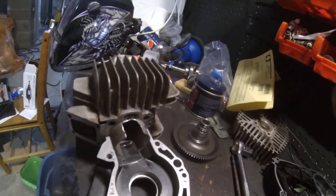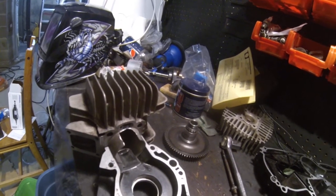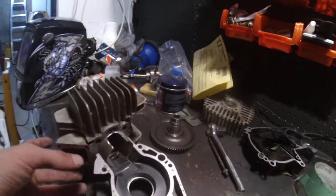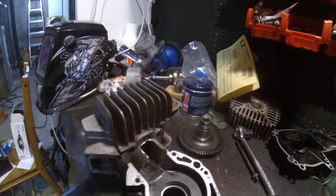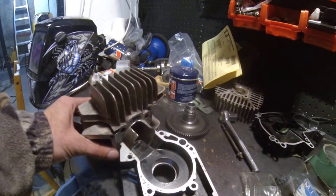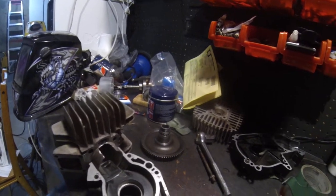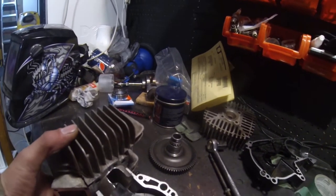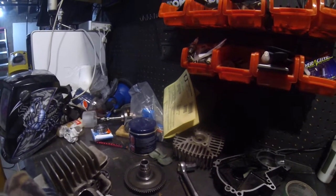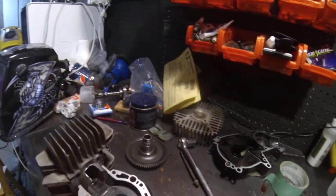Basically the skirt was coming up to about here and interfering with the open flow area I wanted. The piston is wider than what the skirt is, so hopefully I get fairly decent flow compared to what I had before. This thing screamed to about 45 miles per hour — just took off like a bat out of hell, leveled off and stayed there. That seemed odd because I was hitting 80-85 with the other kit, but this one was all low end. Different pipe, different carb, different top — totally different system. Hopefully now I get a little better flow.